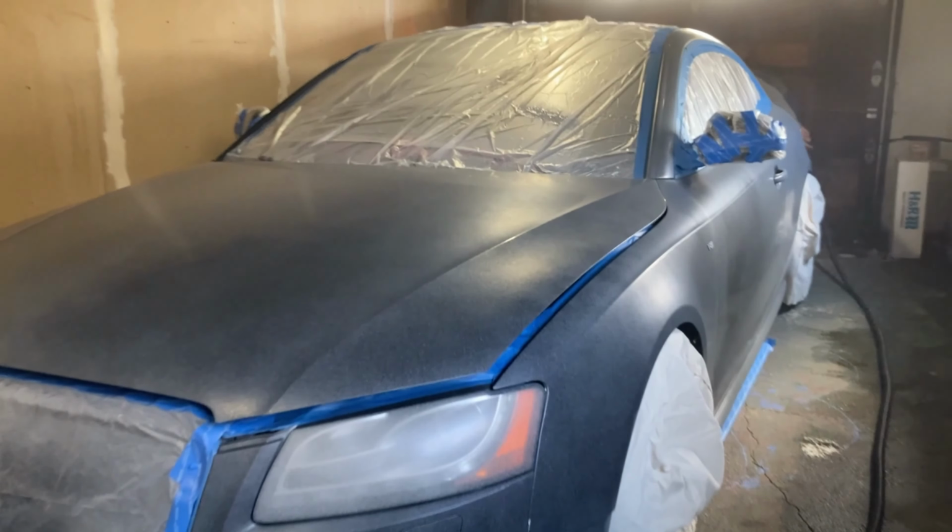For the pearls, you can see that I'm putting everything on the top. You should not do that. You should put a little bit of pearl, then mix it, a little bit of pearl, and mix it. I was just trying to record for you, and there was no other way around it. Yeah, I was running out of hands also. As you can see, all the pearls, all the paint.